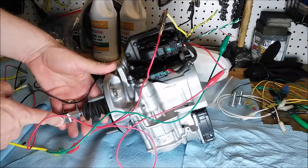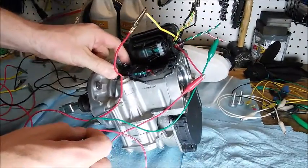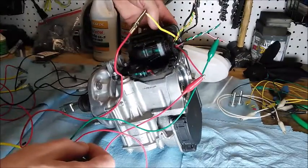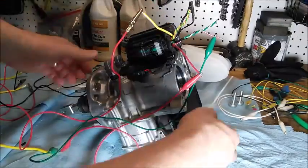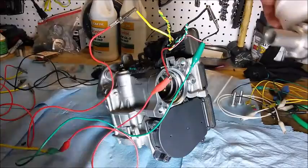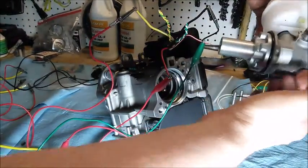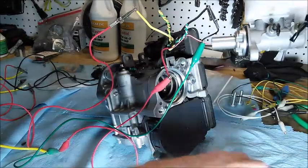This is the fork that goes to the brake pedal. Here's the main unit with the position sensor and then the ECU that controls the electric motors that drive the pinion - this little doohickey here - and there's the master cylinder. This presses into the hydraulic component which drives hydraulic pressure out to the brakes.